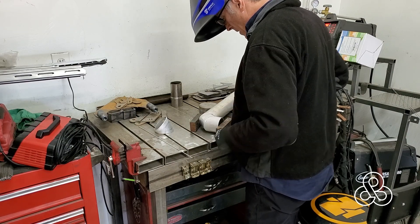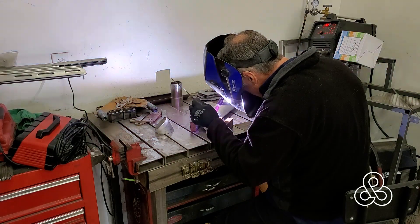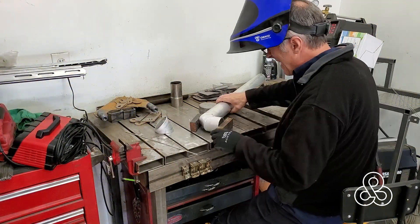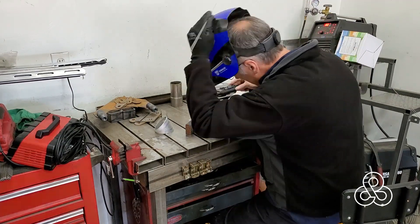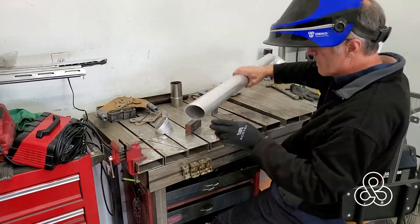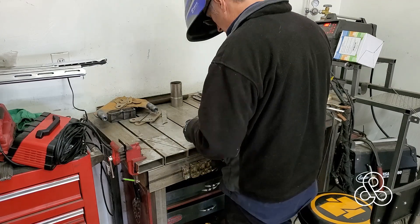I didn't take into account — well, I did take into account that the firewall was going to be an inch thick, about an inch and a quarter with all the laminations done. But once I got it in place, I thought there's just not enough meat on that thing for me to put my rubber couplings on to hook this to the rest of the system. So I added another little kick-up on the end there to finish my bends coming through the firewall.